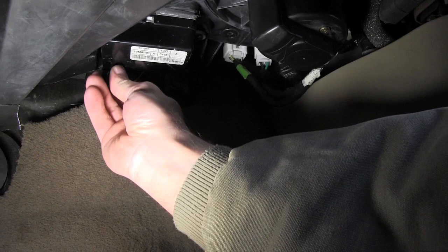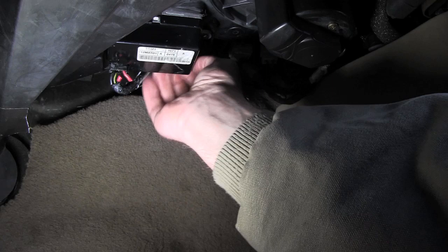It's a little black box down here with a plug in it right here. It's held on by two screws — there's one right over here, and the other one is kind of blind, it's back up in here. But his little plug is melted into it, so what we have to do is replace the whole harness.